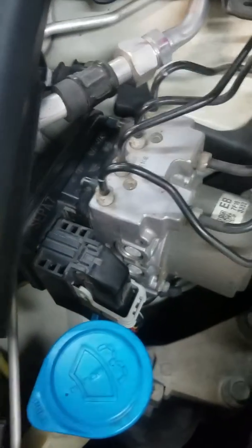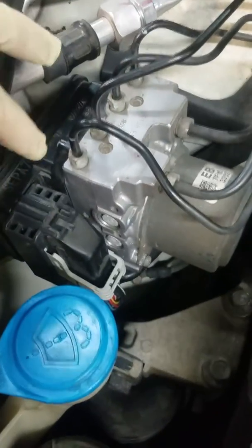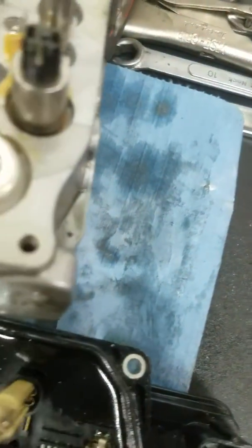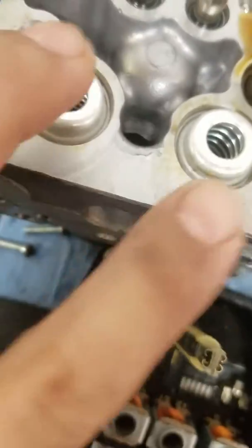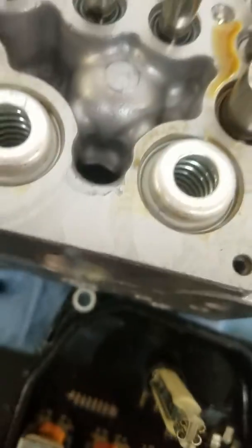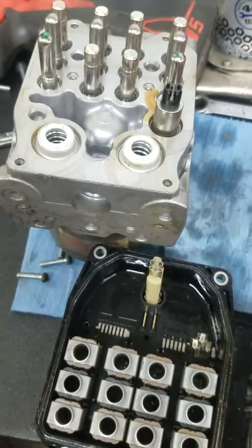You're also going to have to make sure you disconnect the battery so once you unhook all this stuff, you don't mess anything up. Alright guys, I have taken the part off. It's this part right here that normally goes bad — it activates these two little cylinder pumps right here, which when it gets stuck, it will not open anymore. Anyways, that was causing the problem.